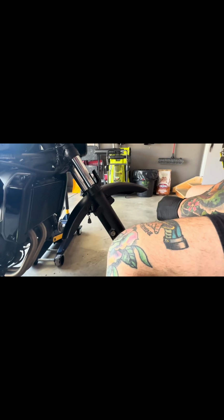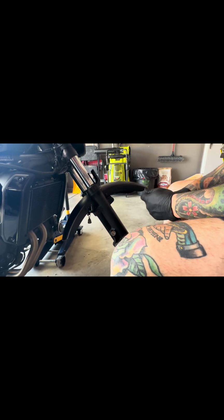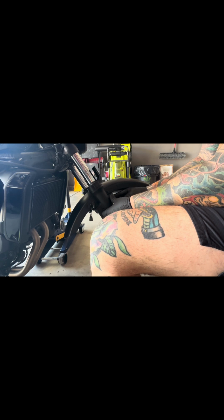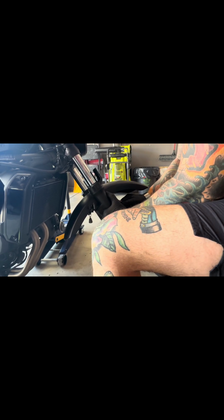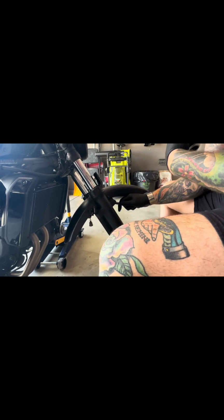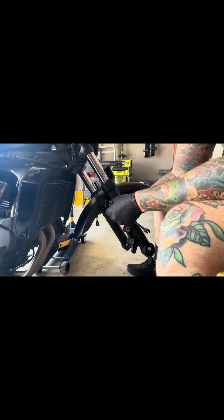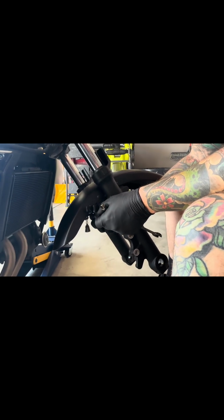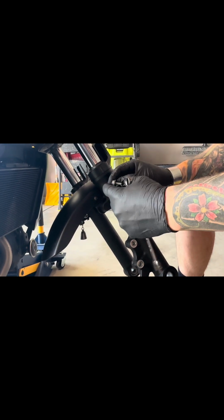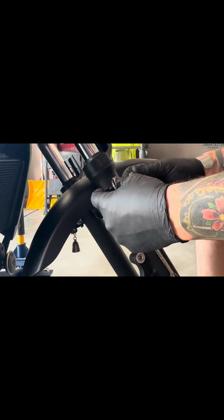Should be good. Once the wheel is off, second step, you need to take this fairing off. All it requires is a 12mm. You can use a ratchet or an open end or closed end, but for the sake of argument, I'm just gonna show this for demonstration. There's only gonna be 4 bolts. Start unscrewing them, and it should come out. On the rear bolt, which is crucial, this was actually holding your bracket for your brake lines. Make sure you keep them together and pay attention to how it was put on. You do have a guide over here and a hole right on the back, so pretty straightforward. You'll have no issues putting this back.